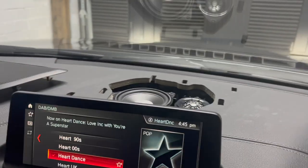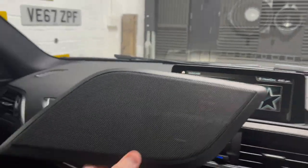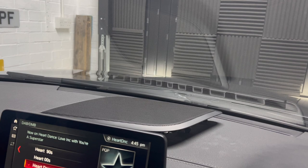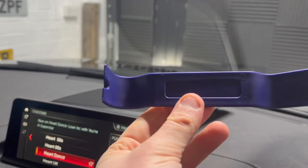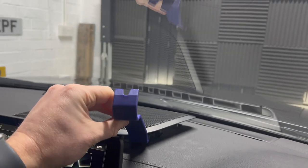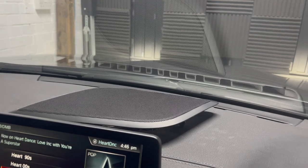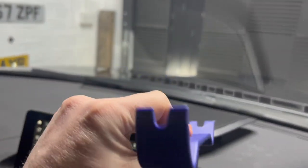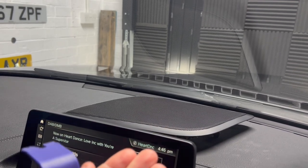As you can see, this is the iDrive screen and at the centre of the dash there are the speakers — I think there's two obviously. This grille basically sits on top. As you can see, there are a number of plastic-y metal clips. Originally I was using a small trim tool that just wouldn't cut it; the trim just wouldn't come up and I felt like I was going to snap the edges. So I ended up using a really quite beefy trim tool at an angle — just got the trim tool underneath and started twisting and prising, and one by one the clips just came up. You do have to prise a little bit more than you'd feel comfortable doing, but with a decent size trim tool it lessens the risk of snapping the plastic. Once you've got one or two clips up, you can get your fingers in and just pull it up all around the edges and it'll pop off.